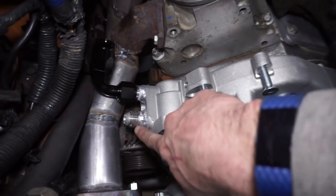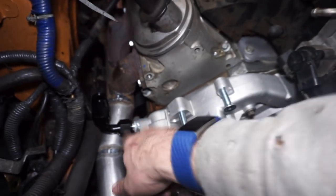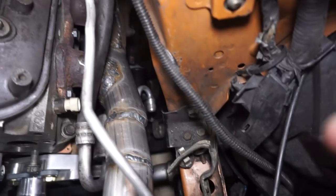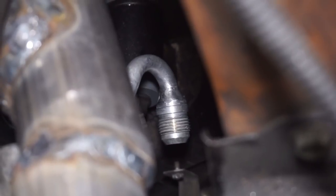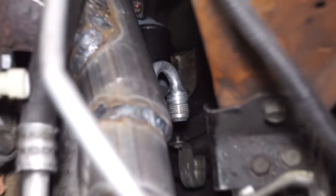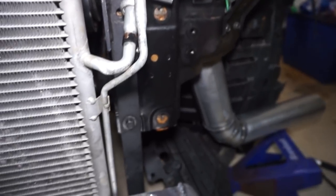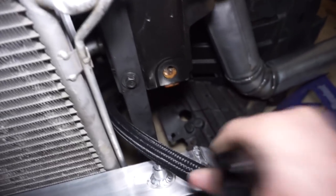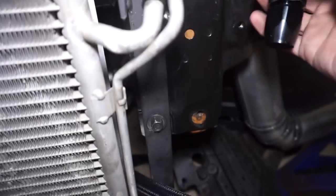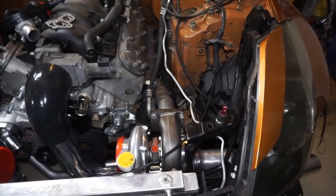These were the bungs I welded onto the water pump - up a little bit higher for the heater lines, which should work pretty well as long as it doesn't leak. The other bung is down on this side welded onto the AC line. I'm going to build a pressure test unit to make sure these things don't leak. My plan is to use a PTFE line or nylon-lined line coming out of there where that other bung was, run that line up here, weld the bung onto this and have a 90 that comes down, and run it straight back to the other side of the AC stuff.